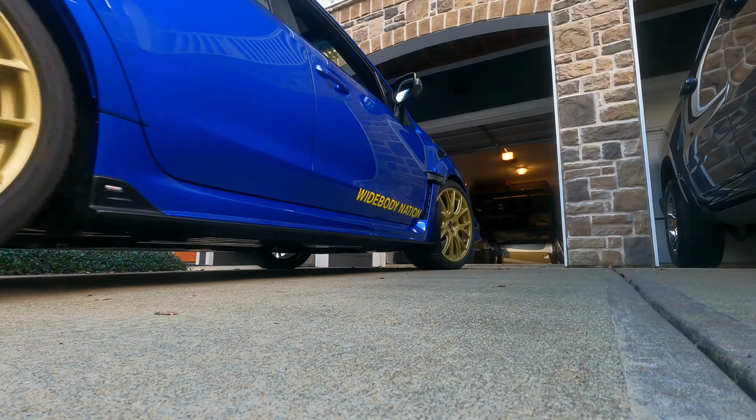I mean, hindsight being 2020, I wish we had gone 1700s off the bat, but I thought we were helping ourselves out with 1300 cc injectors, but live and learn, right? So running up to 90% injector duty cycle on this whole Cobb Flex Fuel setup. Obviously we have the Cobb fuel rails and fuel lines. I'm not going to totally trash the Cobb setup. It's good for now. I'm definitely going to go full Radium when Radium comes out with that dual hanger setup.